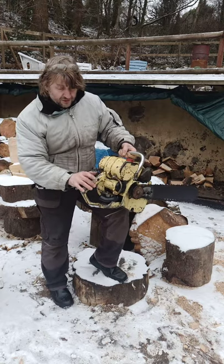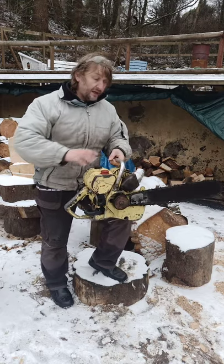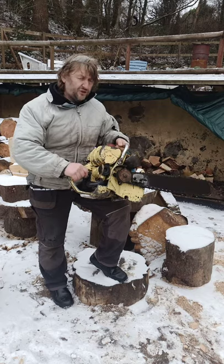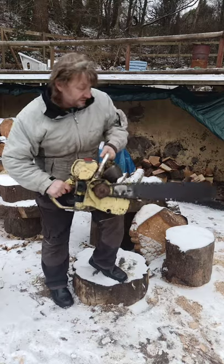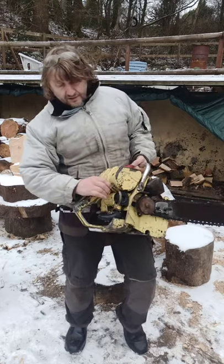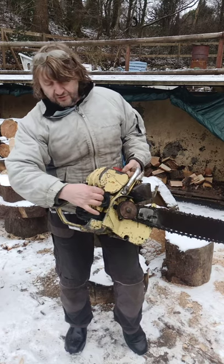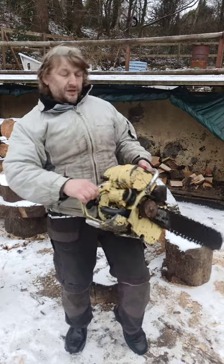I've also had a number of questions from people on eBay asking, is the saw seized? Is that why it's not running? What problems do you have with the saw? But really, this saw came from a really lovely guy who had a huge number of saws, and I simply haven't had any time to get around to looking at it. So with the extra time I had today, I've put on just a makeshift fuel line for now, because it wants one of the nylon covered nitrile lines. One of the vintage lines would be nice with hose clips on both the connectors.